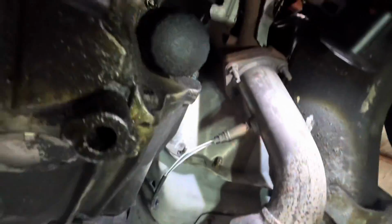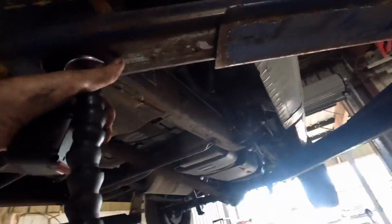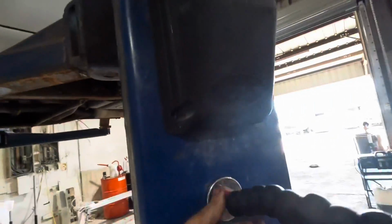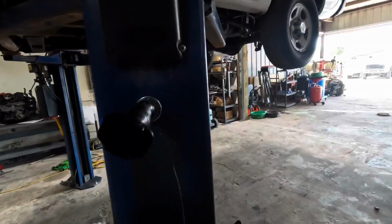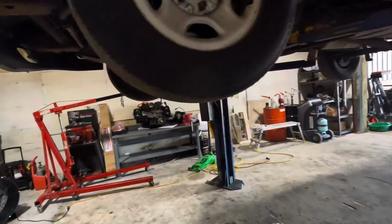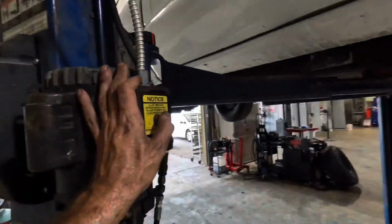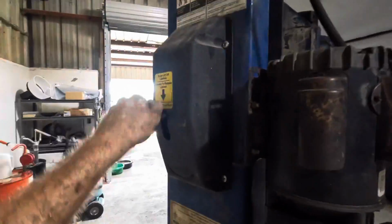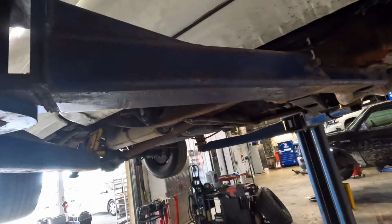Click action achieved. Okay, let's go ahead and climb down, or let this thing down rather, and get our goodies out of the way. Restart the engine. Let it come back up to temp, and we're going to see what those fuel trims start to do. I believe that we had a faulty sensor, but we're going to find out in a minute. Lock release. Silverado coming down.